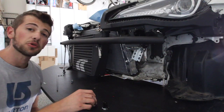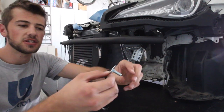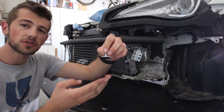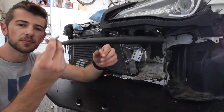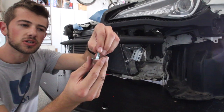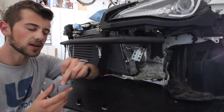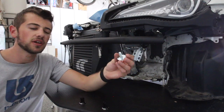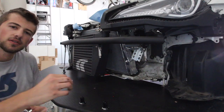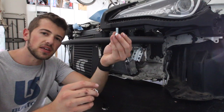To mount the bottom clevices onto the splitter I'm using the supplied carriage bolts. The nice part about these carriage bolts is they have no exposed part on the bottom, so if the splitter scrapes the ground it won't damage the bolts or make them impossible to remove. Instead, there's a square part that locks itself into place in the splitter so you can tighten and loosen it without touching anything on the bottom. To anchor the carriage bolt, put one of the supplied nuts on top once it's through the splitter and tighten it so the square anchor locks itself into the splitter.